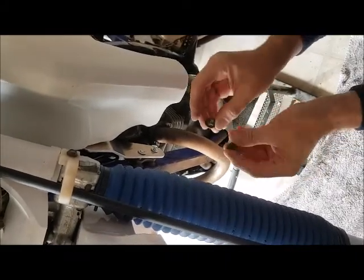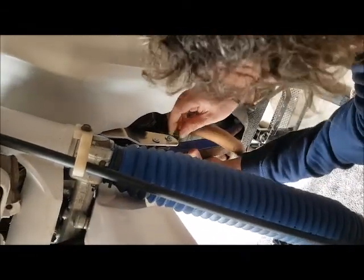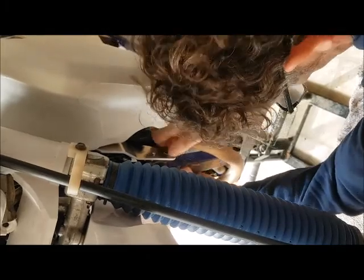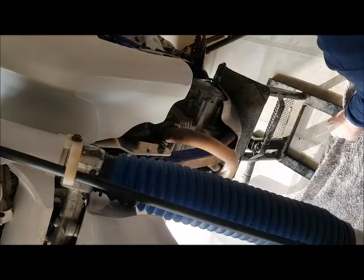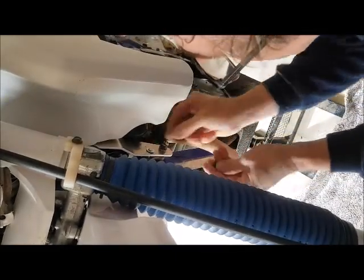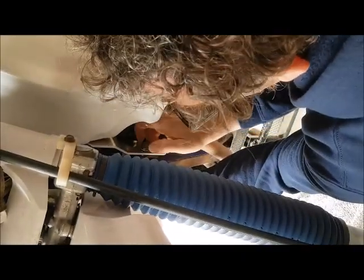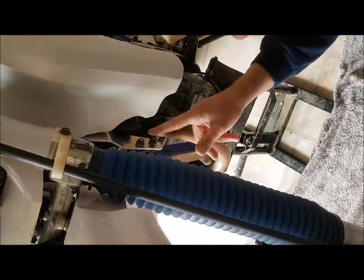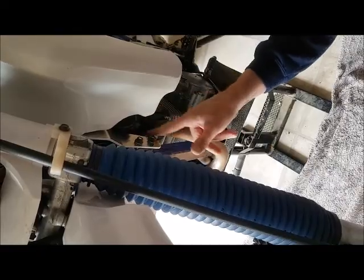Okay, and we're using the old locking nuts off the old engine mount bolts because they're really nice ones, so I've kept them to use them. Again, we're just going to put this on loosely for now, and we'll tighten it all together later. The threads look a little bit longer, but this has been done on purpose, because if any guys run oil coolers, the bolts are already long enough to take the oil cooler mounting bracket.